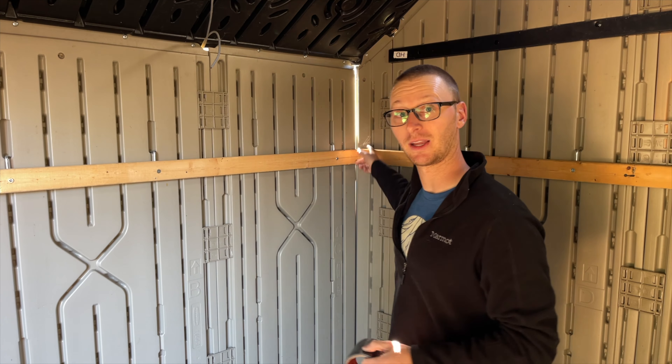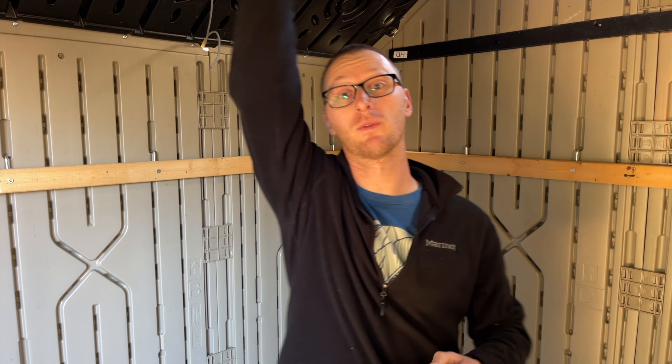Just like I have the crack here in the corner, I also had a crack running along the seam of the roof, because that is also one piece that has been folded to get your pitch. So I took the same black gorilla tape, rolled it across the top, and that's been up there for over two years and it's been holding great. We've had no water through those areas. The tape is still spongy — it's not brittle, it's not hard — it's holding up really well.